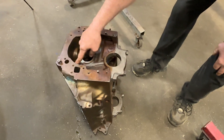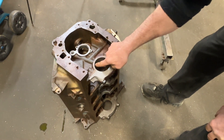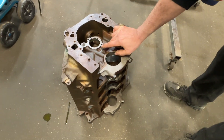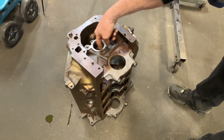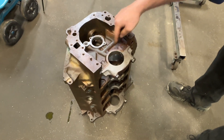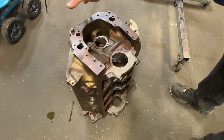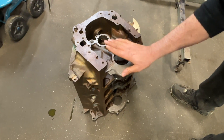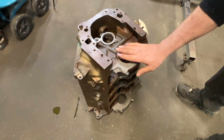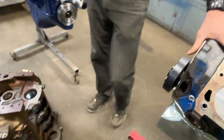What that did was - next in line for the oil flow after this goes up and feeds each one of these main bearings from this lifter galley - the oil comes down here, it's common through the groove in the main bearing, it's common with your cam bearing. So the theory behind that was: if we can rob the camshaft of some oil, it'll keep more here at the mains, because whatever is being supplied by the oil pump goes through the lifters, whatever leaks out through all eight lifters gets left over between the crankshaft and the camshaft.